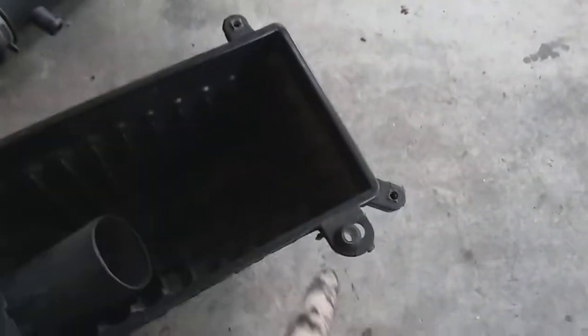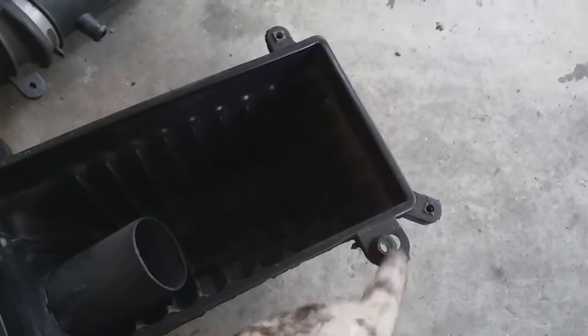The box itself has this piece and it slides into a slot, so nothing to unbolt there. There is one bolt here — on this car it's missing — but you have the one bolt, so one bolt, four screws, and the wing nut and the whole air cleaner assembly comes right out. That's how you get to that one bolt. Very simple — cut down your frustration, cut down your stress, and everybody's happy.